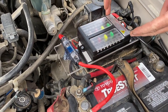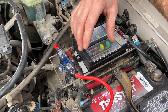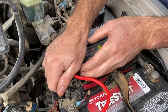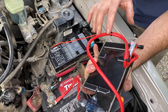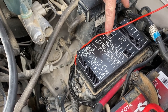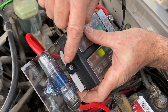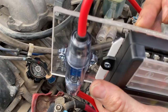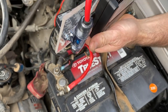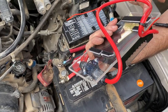After cutting the plastic to size, I put on some very strong velcro — 15-pound strength, which is a bit overkill because it's hard to pull up, but I placed the velcro strips where they wouldn't cover the labels for the fuses and relays. Then I used a drill bit and some small wood screws to attach the fuse panel to the plastic. The screws stuck through the back just a little bit, so I used a grinder wheel on my Dremel tool to grind the sharp edges off.